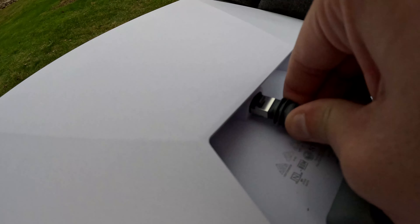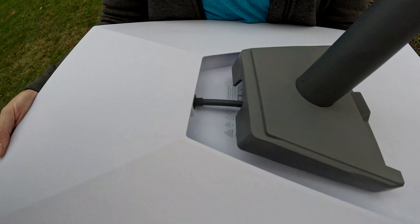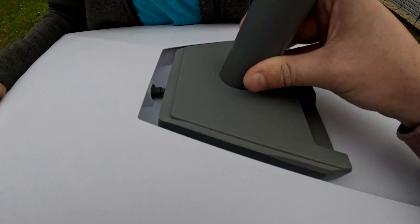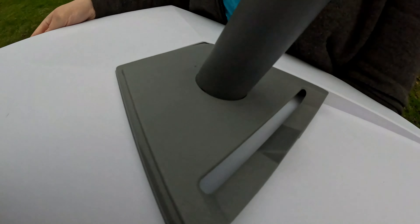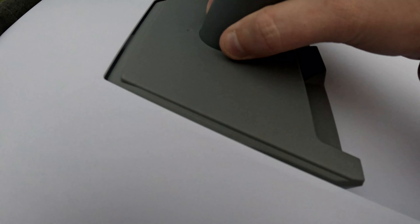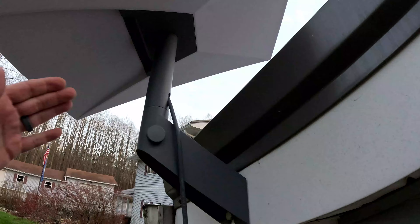When that's sticking out through here, we're going to plug it in with that tab facing up. Then take and plug this in — you're going to have to hold it because I'm going to push. It's plugged in, and then we'll clip this into place, pulling your excess cord out here. Push this up and it'll clip into place — you can see these tabs in the back lock into those locking positions. You can hear it clip into place — now that's locked.